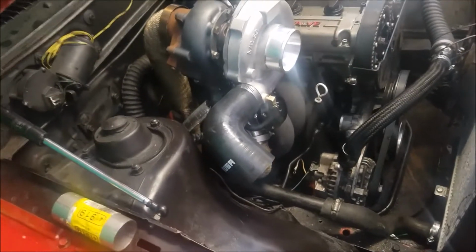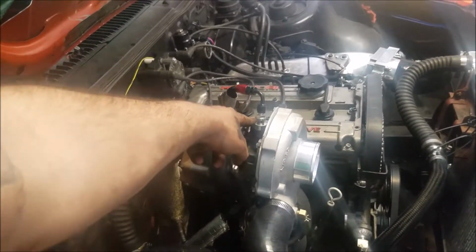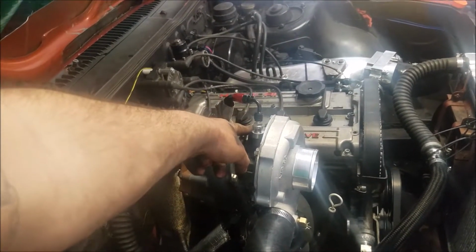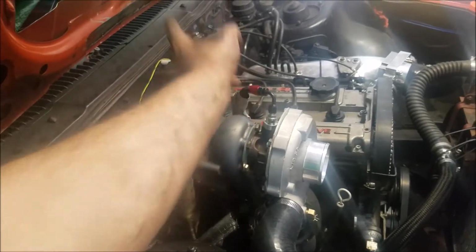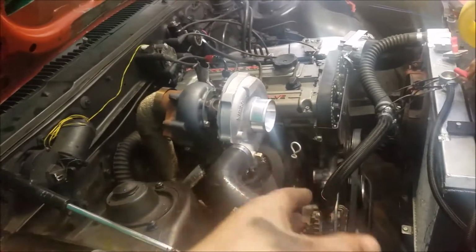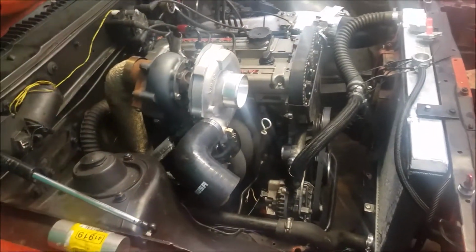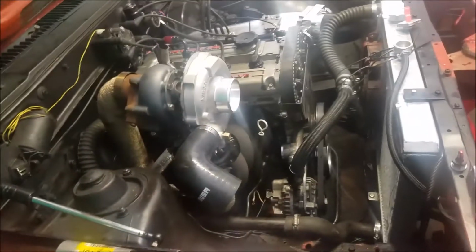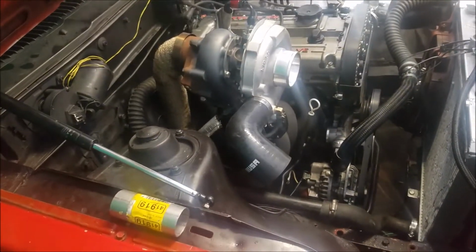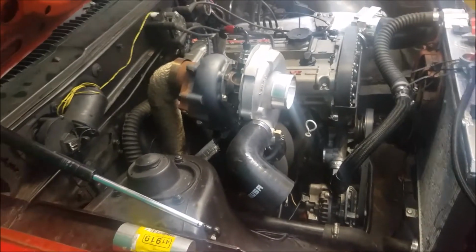Now we've got to figure out the bigger issue, his oil, because it was leaking out, we think, out of here. Did you put Teflon tape on that? Yeah. Have you tested it yet? No. So we've got to test that, make sure that one's gone. The other concern is that this is a front wheel drive engine. It came out of a front wheel drive car, so we're not sure if when he accelerates, all the oil's going to the back of the pan, where the drain is. So we may end up having to mount it up in the front. The bad part about that is we don't really have the ability to do that before Automotion. That would really be bad. But that's where we're sitting right now.